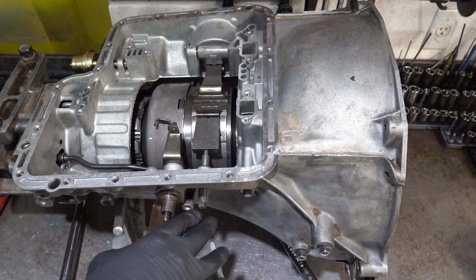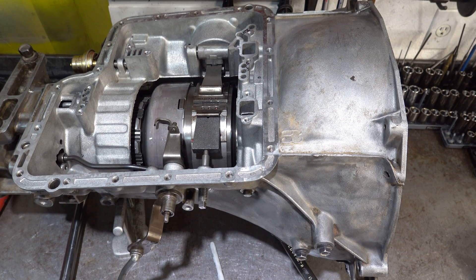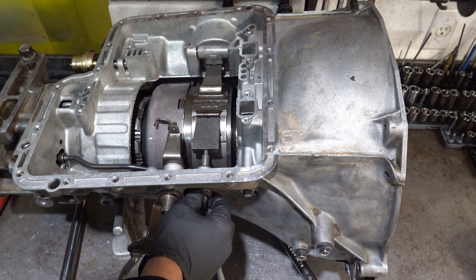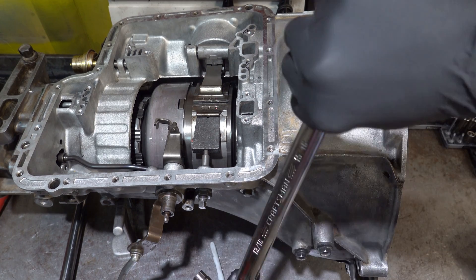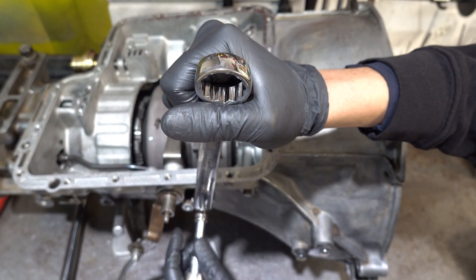Now I want to install the new lock nut. One thing you want to make absolutely sure before you even thread this in: make sure these threads are squeaky clean, because if there's any grit or dirt or crud in them, when you go to install the lock nut it's not going to thread on nice and easy and it's going to move that adjustment screw on you. You can see it threading on nice and easy - that's how it has to be. Stop once you've gotten to the point where it's just beginning to make contact with the case. Then grab the 13/16 wrench and socket and start turning the lock nut inward with the wrench while holding the adjustment screw in place.